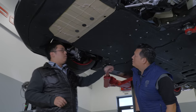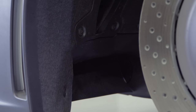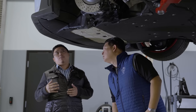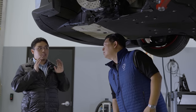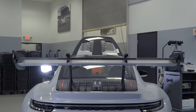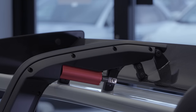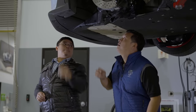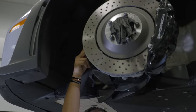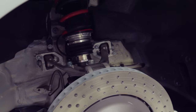Using the DRS system, this actually opens and closes hydraulically in just fractions of a second, directing air either into the wheel well to create downforce or out of the wheel well to minimize drag — because sometimes you want that straight-line speed. This is why this piece is active. And this is combined together with the rear wing, exactly mimicking those motions. That duct we talked about on the front fascia is outputting right here on the top portion as well, which feeds it directly to your brakes.